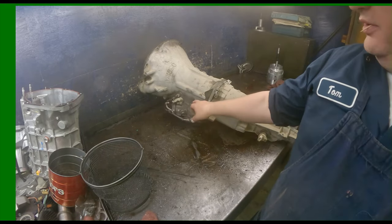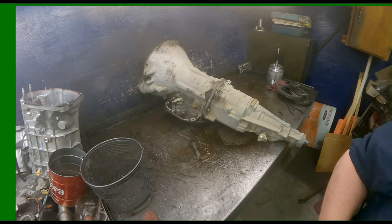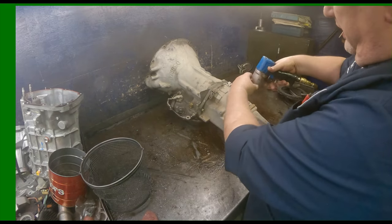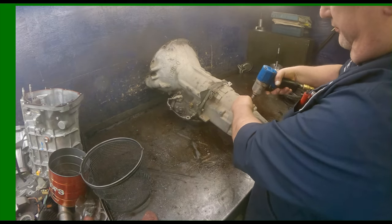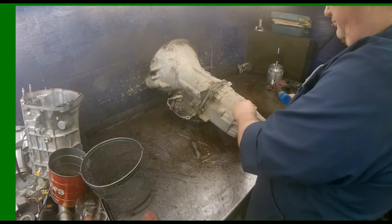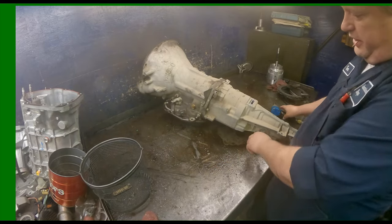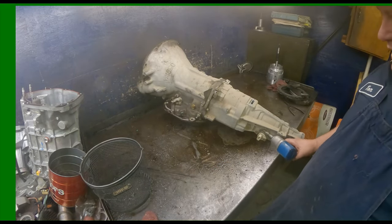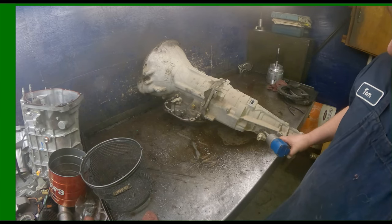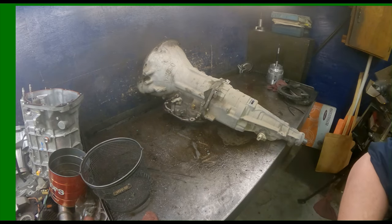A500 hydraulic unit. You know it's hydraulic because we only got a 3-pin connector there. Yeah, 25 Torx on this plate right here. Remember the orientation of your speedometer, even though it does have writing on the side here to tell you where to put what tooth count speedometer gear you have.